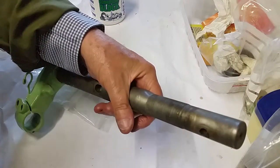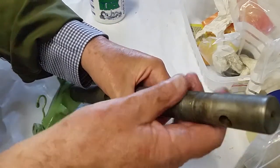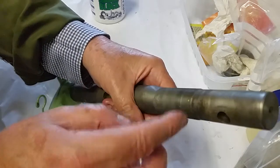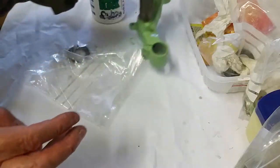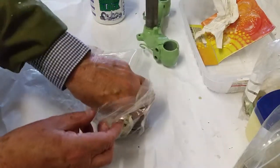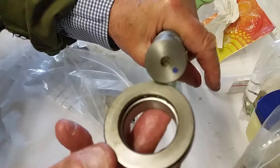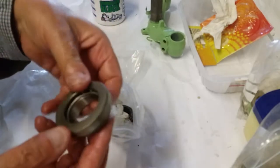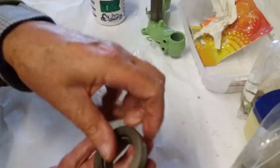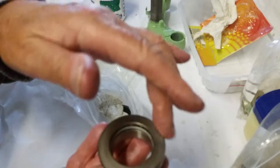The top one, when the fork pushes up, will screw down onto the stem. The stem is threaded down here — that's where the big nut screws down. Looking at the top bearing again, there's a big hole through the middle — that's where the stem comes up through and the top piece screws down over it. We'll find out for sure when we assemble it. This is just an interim video about the steering head bearings, to explain how everything fits.